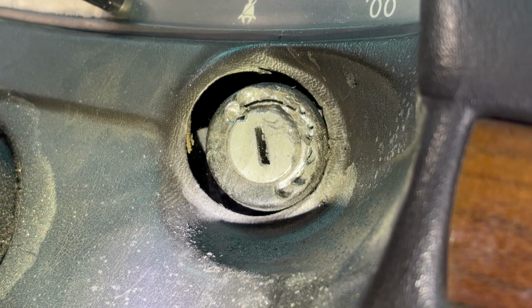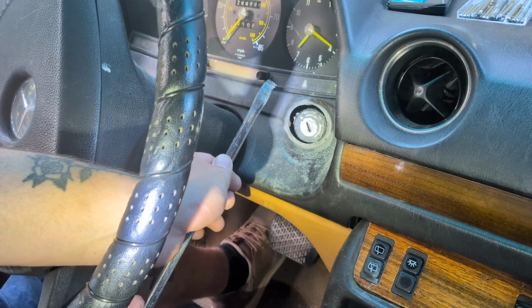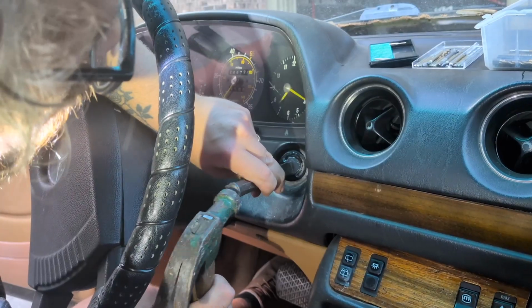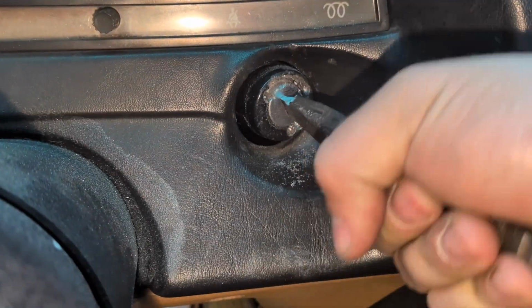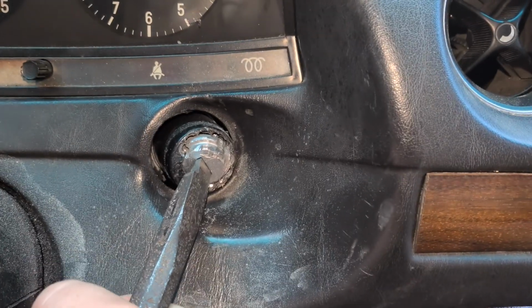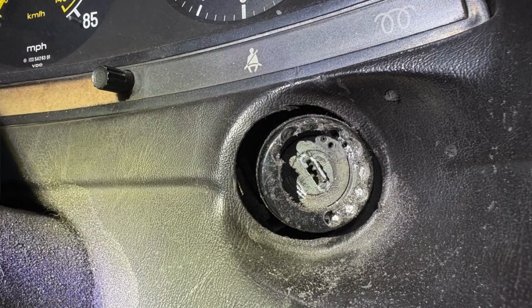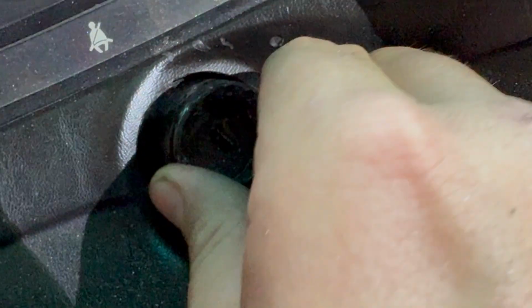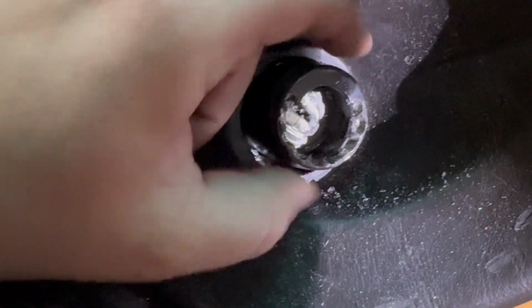The metal is too hard for standard drill bits or even cobalt drill bits, so I primarily used about a dozen 3/8 inch masonry bits which have a carbide blade, and I had to repeatedly sharpen the carbide blades with a diamond cutting disc on a Dremel tool. Eventually I was able to pry out the face of the lock cylinder, which itself is made from hardened kryptonite or something. Once that was removed, I could push down on the pin that prevented the protective casing from unscrewing, and once that was removed, I could pull out the lock cylinder and was able to finally access the ignition switch.